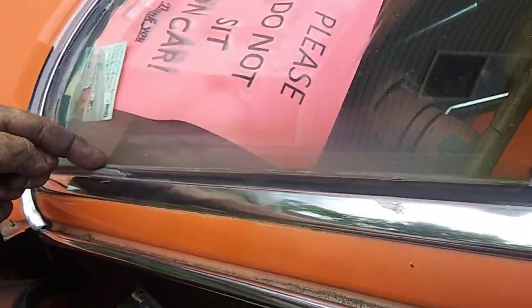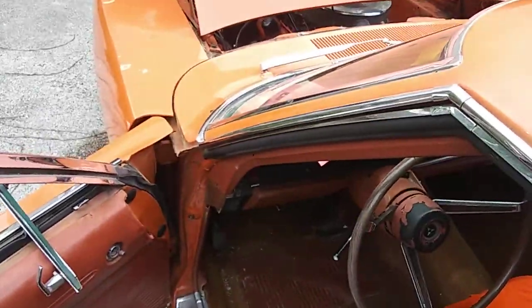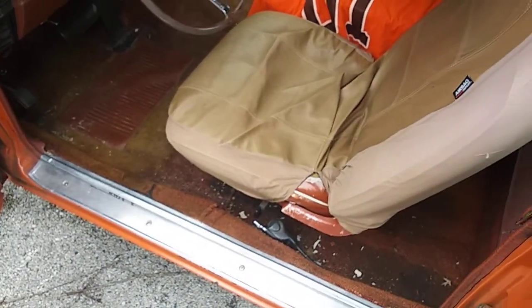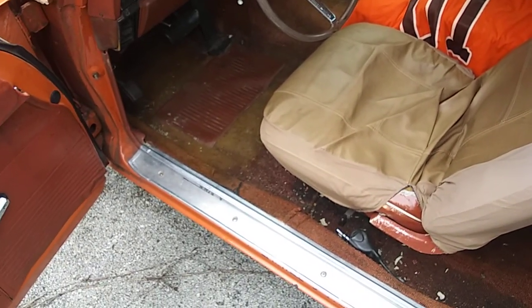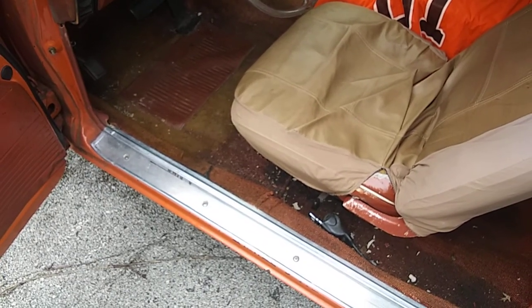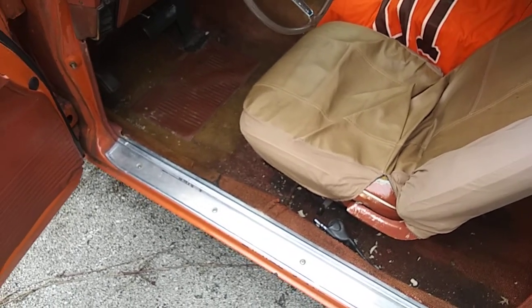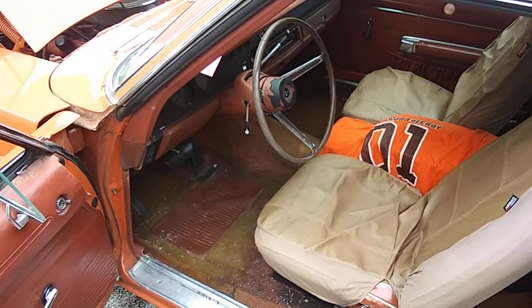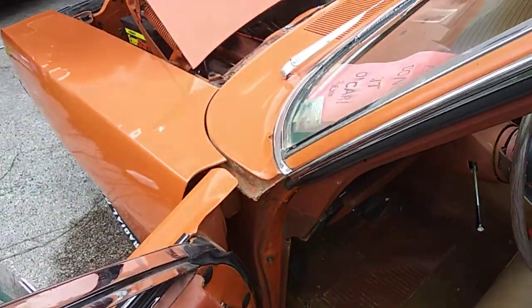I think what it is, he's got an issue right here going down the side around the windshield that's starting to leak. We're going to get some clear high temp silicone seal for that. But I went ahead and made sure all the points of entry on the bottom of the dimmer switch where water could possibly get in, I greased it all up with dielectric grease so nothing gets in there, especially around the electrical prongs and stuff like that. And I also greased the factory connections inside there so the prongs won't get corroded or rusty.